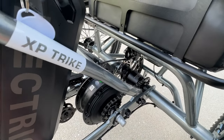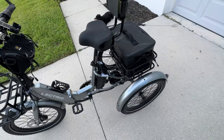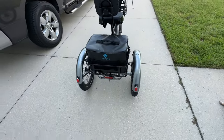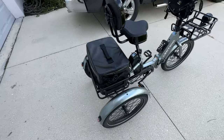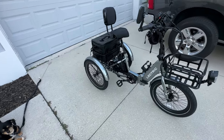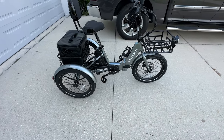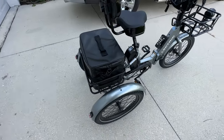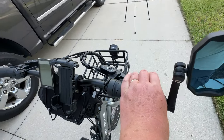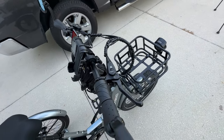Right behind the motor you have the rear disc brakes. We had problems with those — it turns out they often come shipped from the factory with oil on the disc. If you don't clean that before your first ride, you're going to contaminate your brake pads. We didn't know that, so we contaminated the pads, and the result was when we tried stopping, we couldn't — the pads and disc were both oily. That problem led to another: while trying to stop, I ended up breaking the brake lever. I squeezed too hard trying to get it to stop and something inside snapped off, so we had to wait to get that replaced.